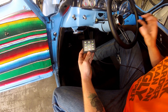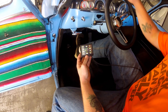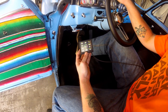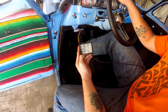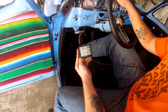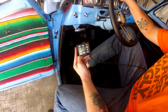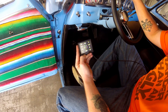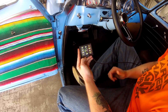If your idle is fine but the engine dies when you come to a stoplight, one way to check is to put it in gear, hold the brake, and watch what your IAC does. The IAC should come up to compensate for the added load. The RPM is staying pretty consistent here, though the timing is sawing a little bit — I may need to look at my timing table. Back to park and it drops down to about 5%. The IAC adjustment is working well.